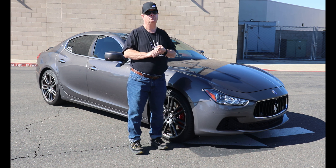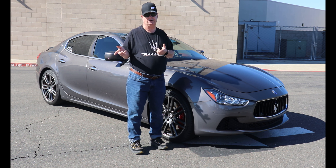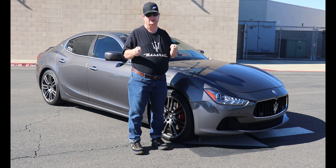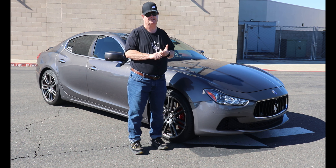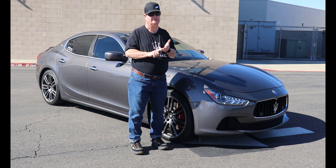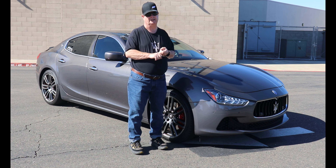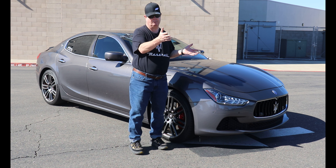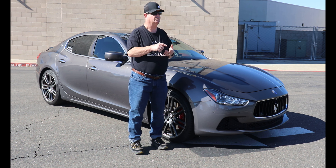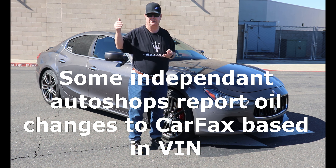Another thing: maintenance history. Please do what you can to find out how it was maintained in the past. You can get the VIN, call the Maserati dealership — or if you have one in your area, go there and give them the VIN and ask them for a printout of all previous maintenance history without prior customer names. I was able to get that for my car. What I'd be looking for is oil changes — how often were oil changes done, were they consistent? All the oil changes may not be in that report if they were done outside the dealership when not under warranty. If you get an oil change at a good dealership it will have records in the CarFax report.